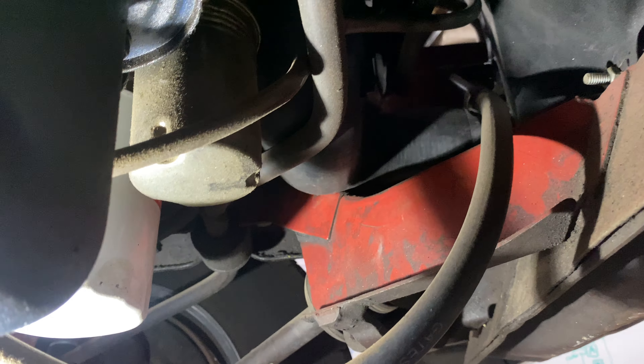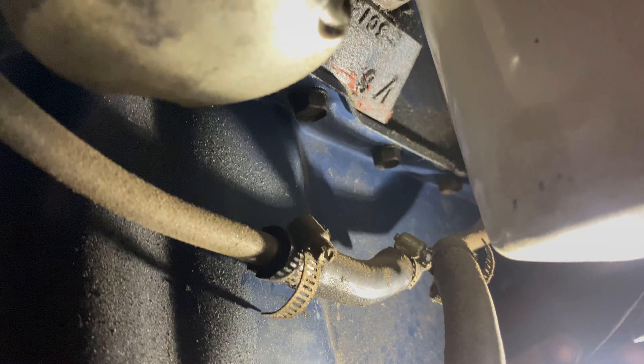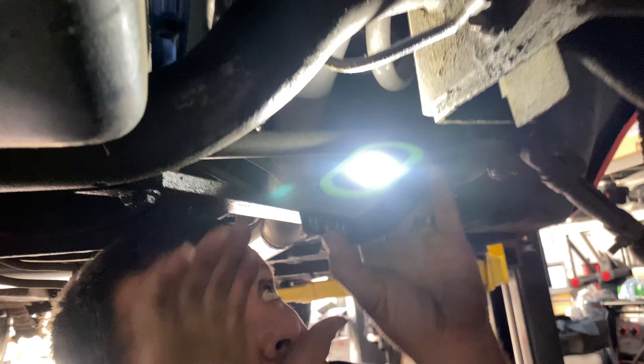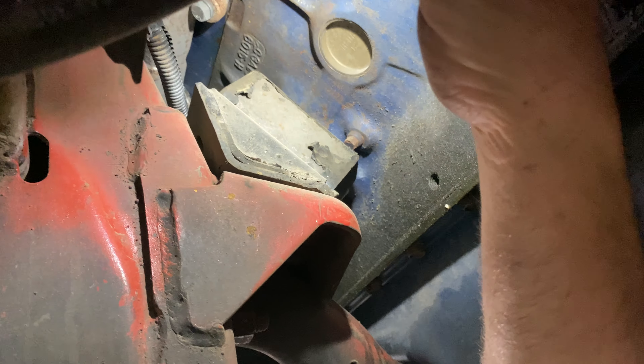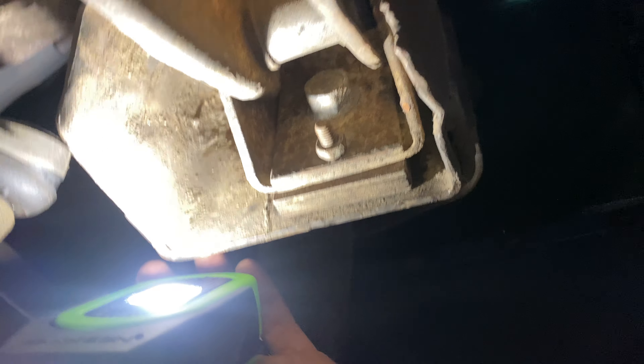The trans cooler lines have been hacked off and put on pure rubber all the way up, so we might want to think about that. The dipstick tube's been silicone-bombed but it's not leaking anymore, and neither is the oil filter adapter. The motor mounts — they've been recently replaced, looking pretty nice actually, not dry-cracked or rotten. This radius arm bushing isn't as bad as the other side but it's pretty tired. Lower control arm bushings actually look really good — those have been replaced before as well.